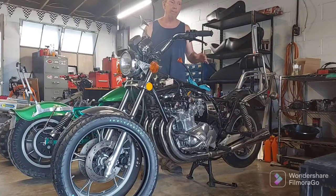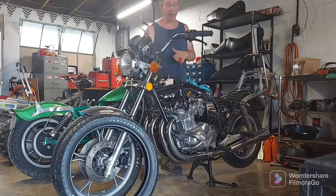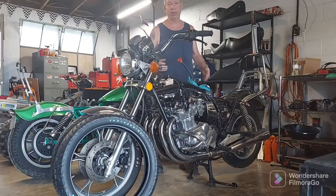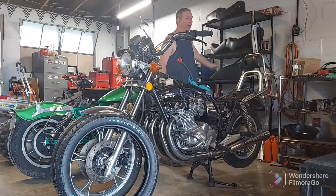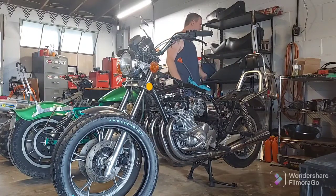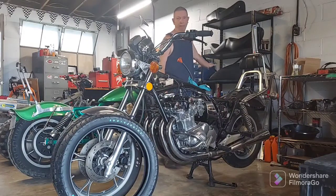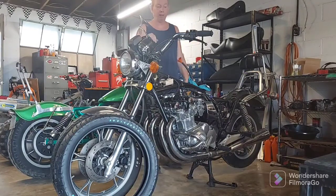Now I can get back on some of these projects and knock them out. This should have been way further along, but I had some problems with the paint job. This is what I call a four-stage paint job. Here's the tank in primer. I already had the base coat on once and had to sand it off. I call it four stage because you get a black base coat, then the burgundy red, then your stripe, then you clear coat it.